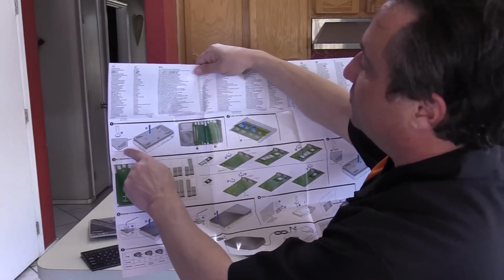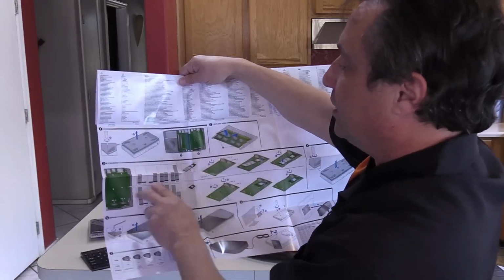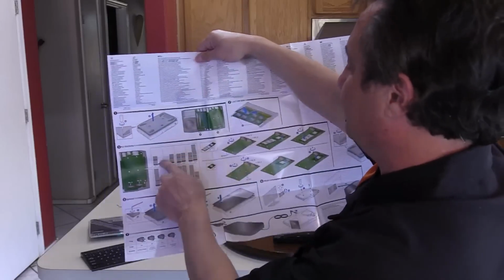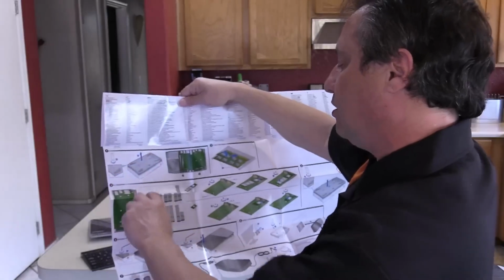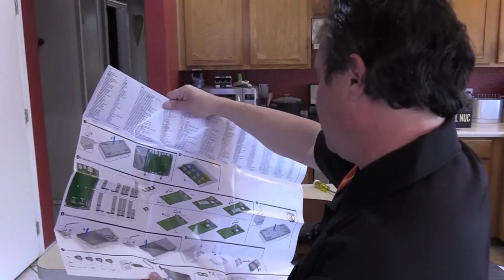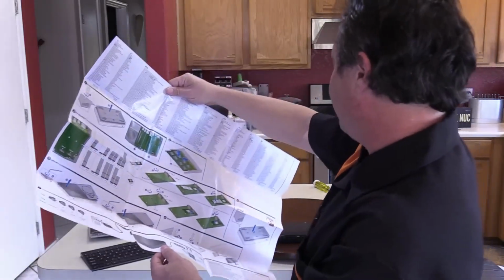Take out the screws from the bottom, and then it lifts straight up, and that's access to our RAM. And then there's two M.2 slots, so you can have two M.2 drives, and it looks like it'll support multiple size M.2s. Everybody does the 2280. It's 22 millimeters wide and 80 millimeters long, which you'll see here coming up. I think it'll do either SATA or PCI Express, but we're going to use PCI Express because with the QLC type SSD, it's the same price as SATA with 3 times the speed. So why would anybody want to go back to SATA? We've already evolved past that.